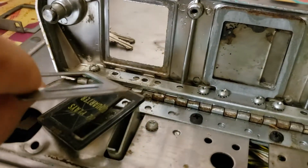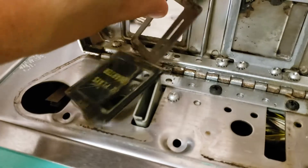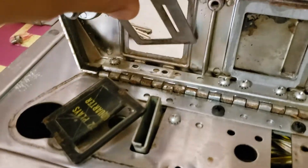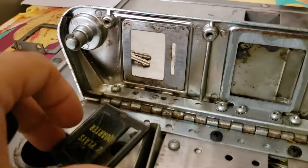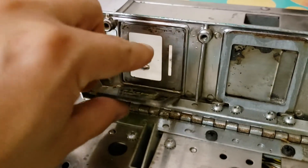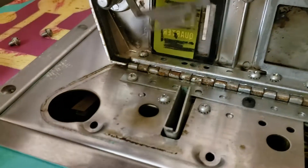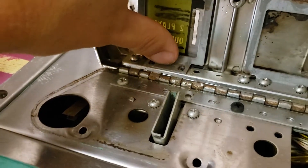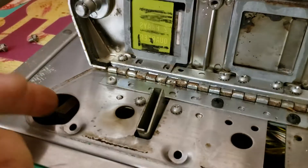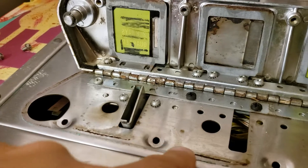Reinstallation works the same way. So if you had a replacement plate that I made for you, you put your coin slot back in like this, and then you take your new one that I made and put it right in here so that the 3D portion sticks through the open window. Then you put your L-bracket back in right here, put your two screws back in, open the door up, and then put the four screws back in that hold it closed from these four holes here.